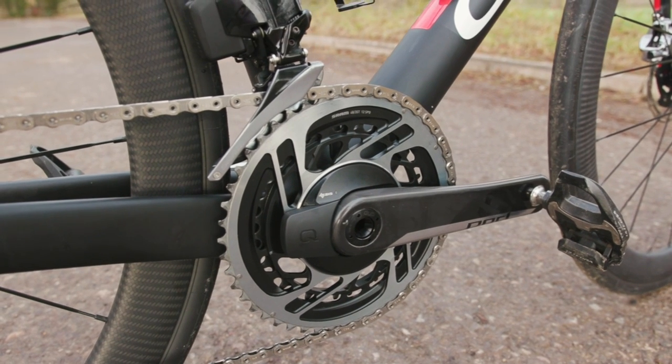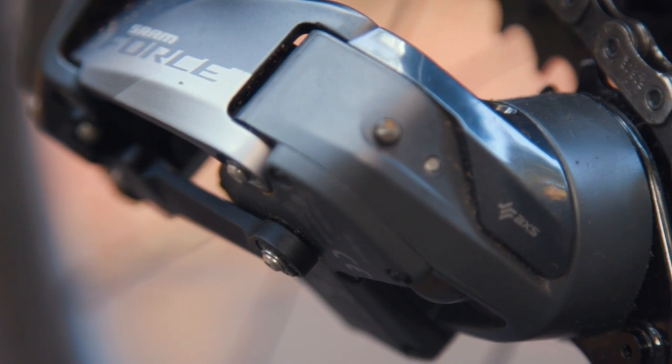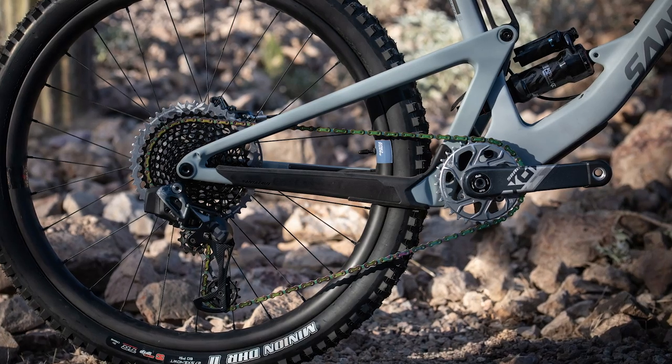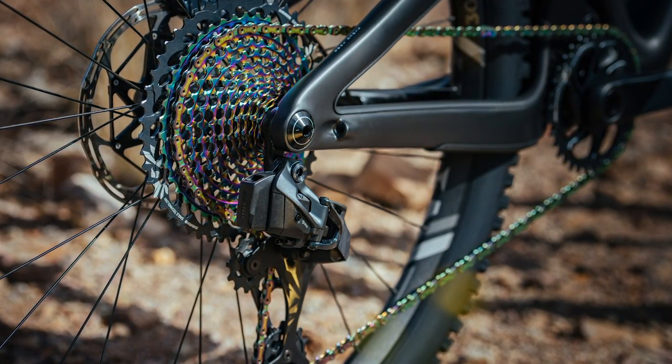Incidentally, it's one rear derailleur for all cassette options, so again, you don't need to think too hard about compatibility here. Also, the road AXS groupsets are compatible with Eagle AXS mountain bike groupsets, which opens up another whole avenue of extreme gearing if you want something ridiculous for your loaded touring, 3-inch tired adventure bike or something.